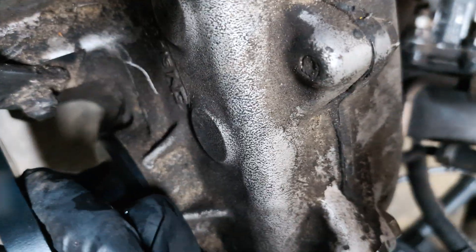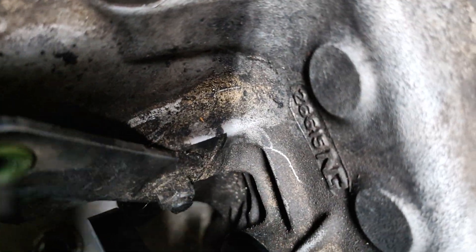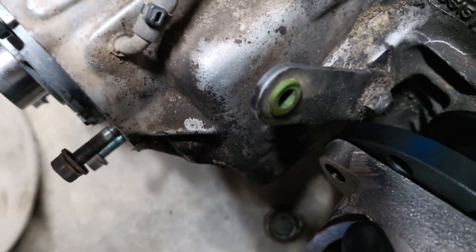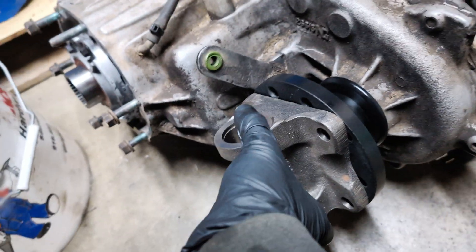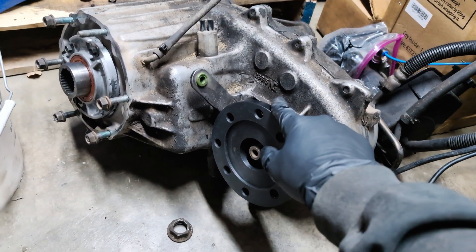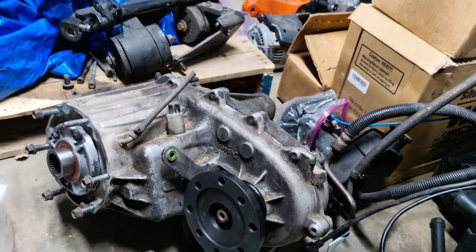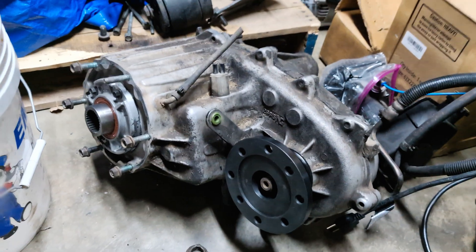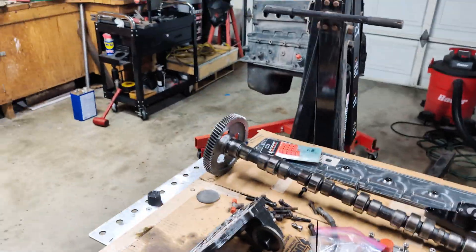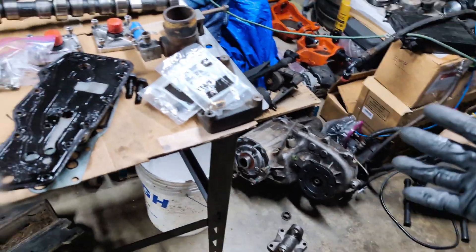With the quarter inch taken off, you can see the clearance — it's probably about three-sixteenths of an inch, so I do have plenty of clearance. And when you put a Rockwell U-joint on there, it's not any bigger — it just spaces it farther out, so there's even more room. This will put a Rockwell end on the front output of your T-case. I'm doing that because later down the line I'm going to a 205 doubler, and this way I can do one driveshaft — Rockwell on both ends of the axle and the T-case. But that's it, those are my updates. The next video is going to actually show things going together.